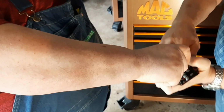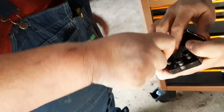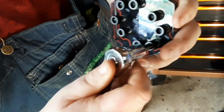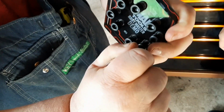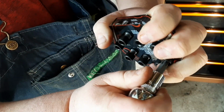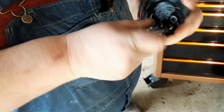So go ahead and take it out of there and put it into that rounded one. And make sure you get it down into the bottom there. Here, you hold the block yourself. You can feel the fit when you get it down in there. Oh yeah, down to the bottom now. Tighten her up. Now crack her loose. Go back the other way and you can feel it just engage. There we go. And out she comes.